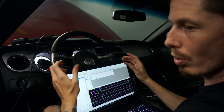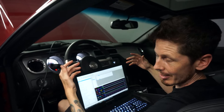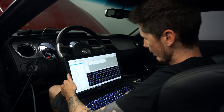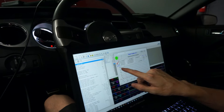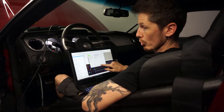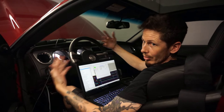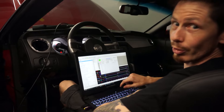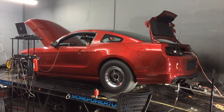Once we start boosting it, this will tell me what extra fueling we need. We'll start without extra fuel and see what it needs, then I'll make adjustments. This is a table that matches the fuel injectors. Once I look at that, we'll have an idea of what we need to modify in these tables — we'll build the tune without that and then let it tell us what it needs to deliver the target. Finally got that working. Only took three days.